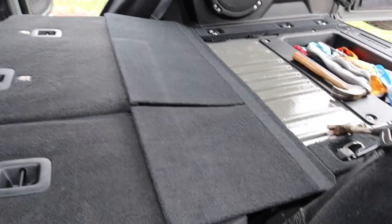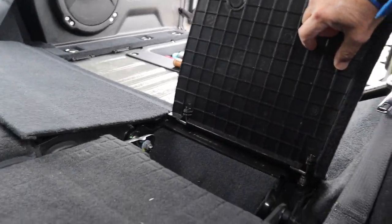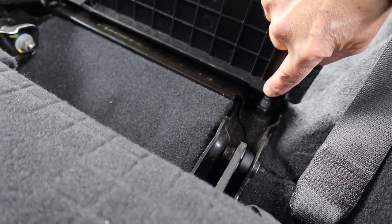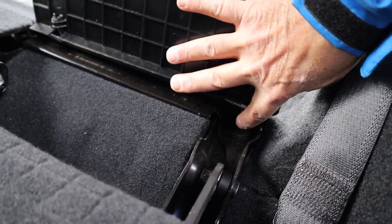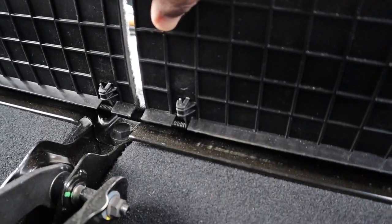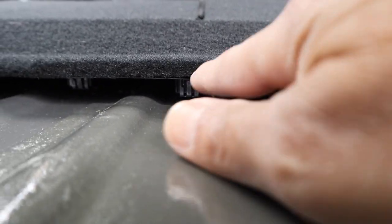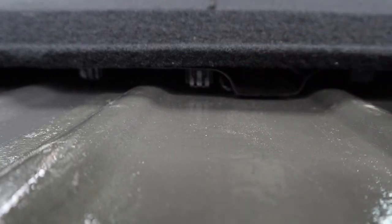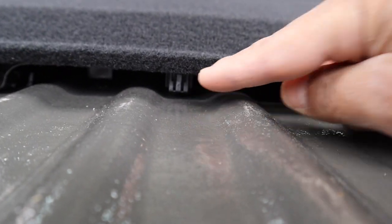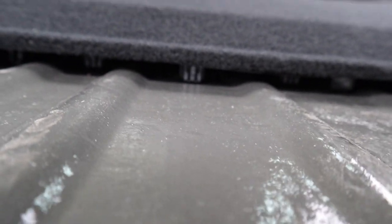What we're having a look at here in the back of the Sahara: the seats have a gap cover that not only covers the gap, but as you can see here, they cover the bolts where you have to get access to in order to remove the rear seat. Now underneath that cover, under the edge are the clips they call alligator clips, and those are the clips that are holding the gap cover in place. You have to remove the gap cover in order to have access to the bolts.